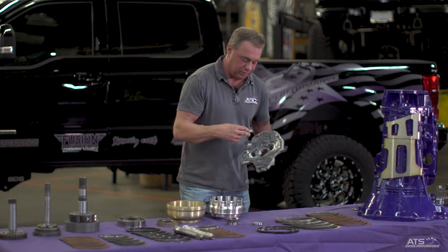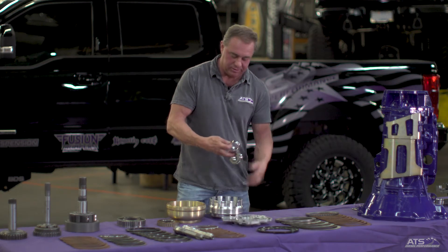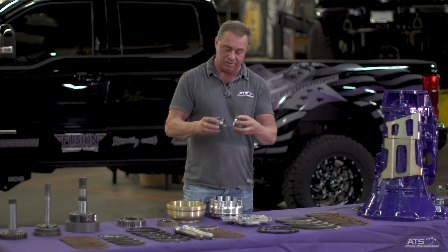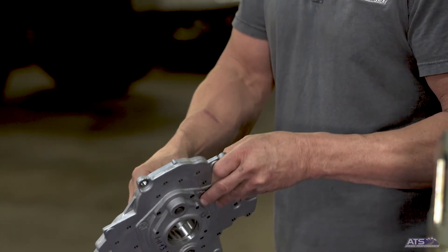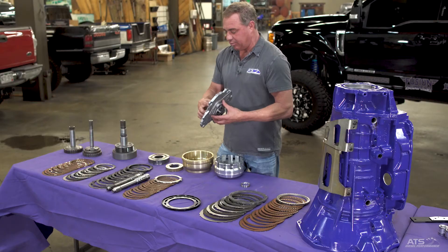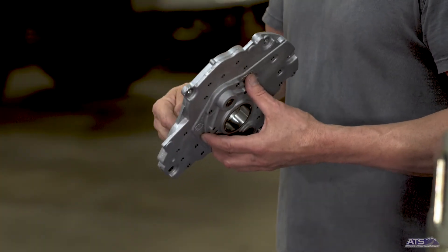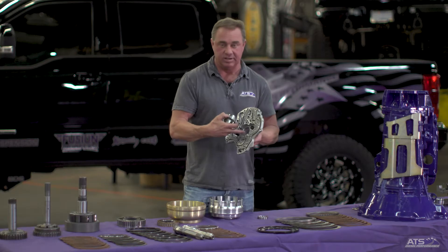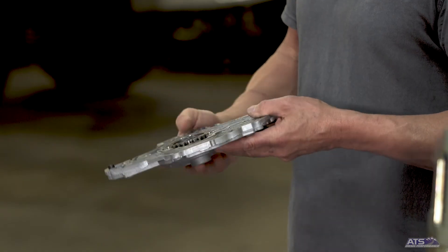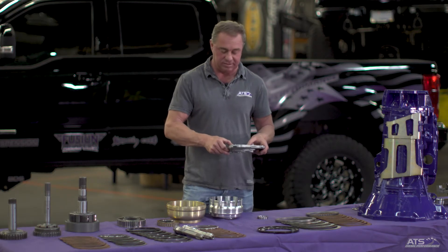What we've done is bore the pump out and put a nice bushing in it. Now we have this bushing that fits inside the pump, and all your thrust and load relies on this bushing — like conventional transmission design. The pump gear rides on the Babbitt bushing and rotates. When we increase oil pressure up to about 270 psi, we don't have that failure of aluminum pushing into the steel, losing the oil barrier and wiping out the pump. Now we have a pump sustainable for up to 500,000 miles — which is our warranty.